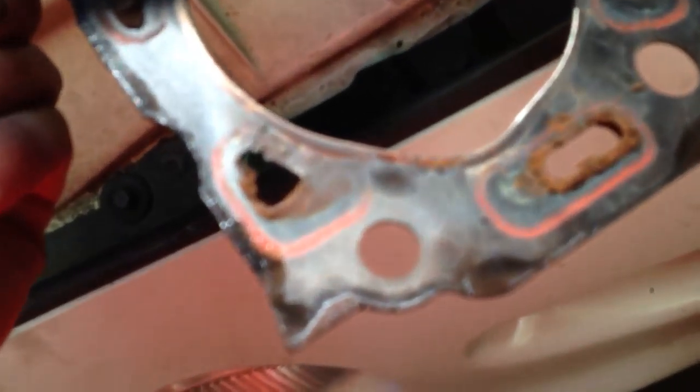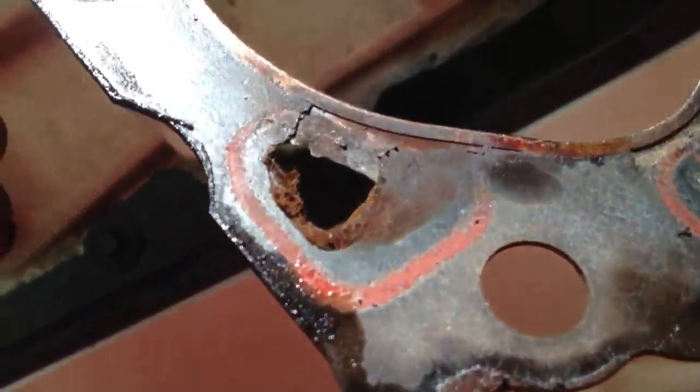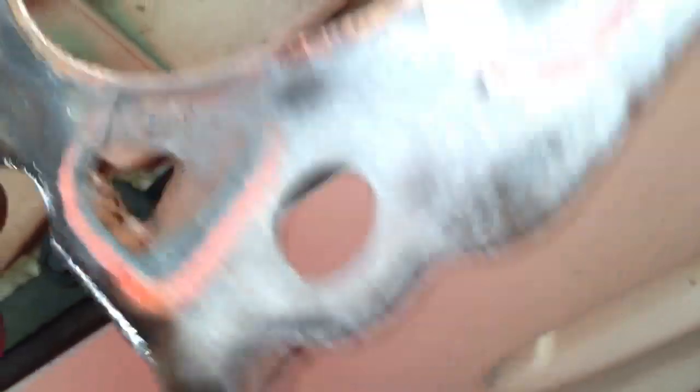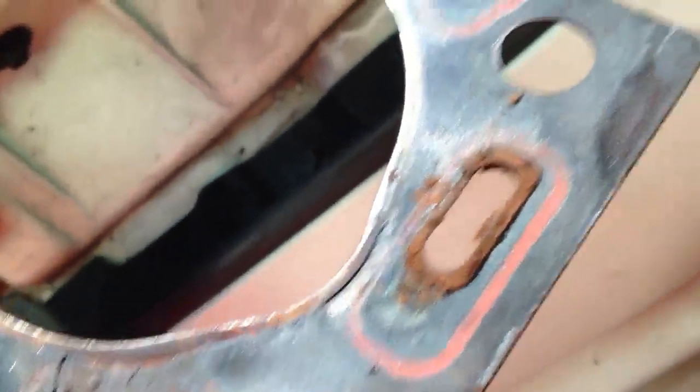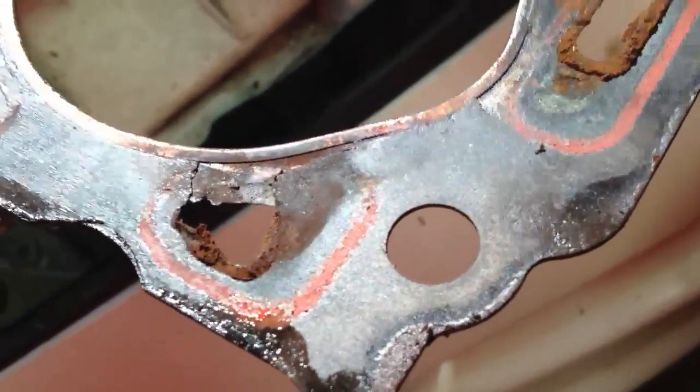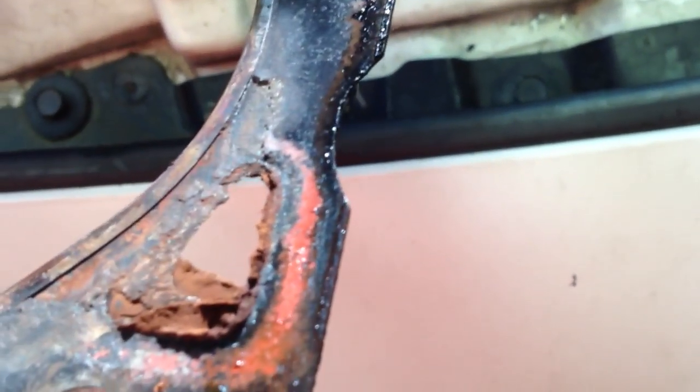Grab the blown one — here it is. I'm going to set this over here where the sun's good. You can see this mark right there — that's the water going into my head, my seal. Looks like it had a little there too. It should look like that where it's sealed, but instead you've got this break point right there. That was initially my problem. Back side — so I did have a blown head gasket, in case anybody has this problem and would like to know.